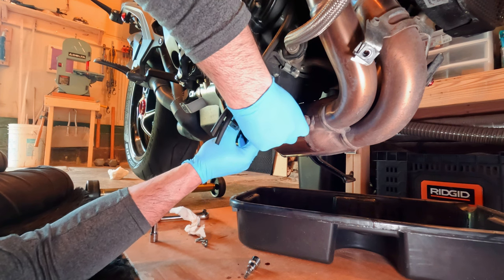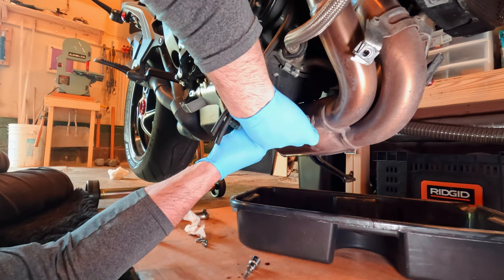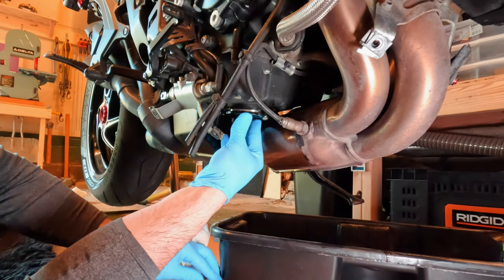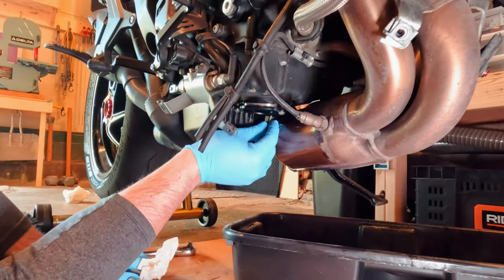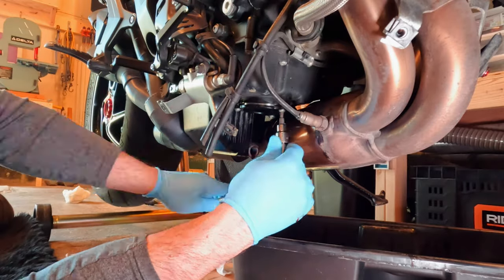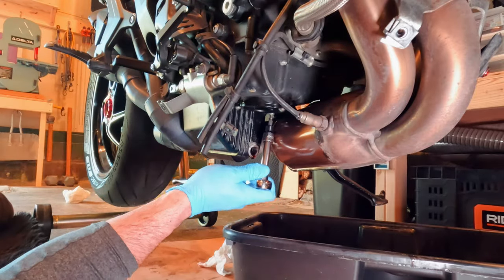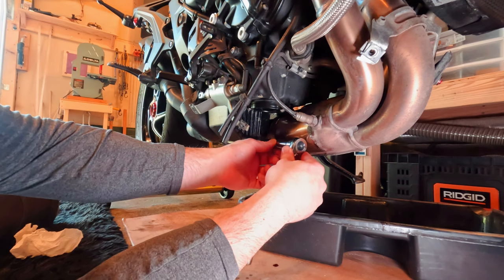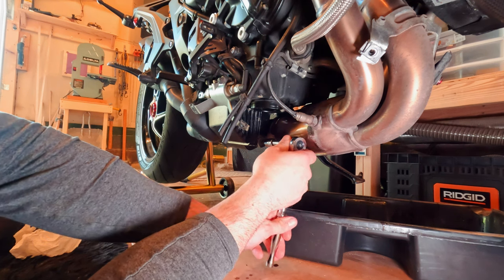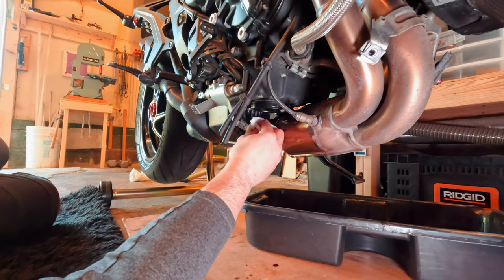When you're installing the oil filter, you want to make sure that it stays straight on top of the spring and doesn't tip side to side — that way it will come up into the center of the opening and make a nice seal. There is an O-ring around that piece we removed, so it will be a little snug when you first put it in. I like to get it set in there by hand, then hand tighten the screws, and then come back with the socket extension and socket. I do not know if there are any specific torque specs for this — the manual is not very detailed — so I just make them hand tight and then give them a little twist after that. They are small screws so I don't think they need to be that tight. After that's done, we reinstall the oil drain plug and give one more wipe down.